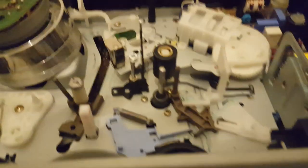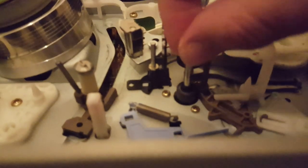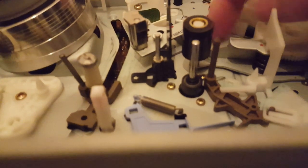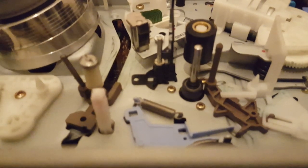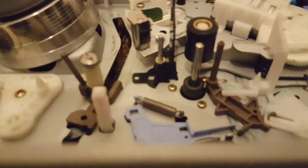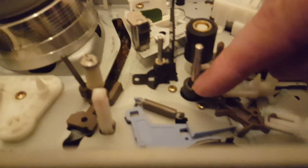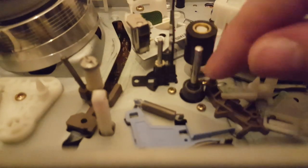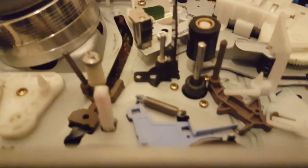If you've got no motion at all or the video just shuts off and won't play, take the capstan and try to move it with your hand. If it freely moves and you can feel the wheel spinning underneath, that's fine. If the post closest to the pinch roller is not moving, you've got a problem with your capstan — either a sticky belt if it's a belt-driven machine, or some corrosion. To fix corrosion: pop the clip off, put some penetrating fluid down the spine of the capstan shaft, work it in, then clean it off with kitchen roll. You don't want any grease left on the exposed shaft — you want it down inside so the capstan can move freely and spin.